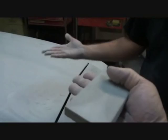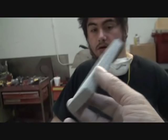Do you see how you're rubbing that with your hand? Can you put your hand like that, please? What we got here, we got grooves in between our fingers. When you're using your hand like this, you are actually putting grooves in the paint. So when you look at it with the clear coat and all the other paint on it, you're going to see all these ripples and waves throughout the paint job, and that's because why? You're not using a block. You're not using the special handy-dandy block that my friend Pete just showed you that costs like $3 for a two-pack.